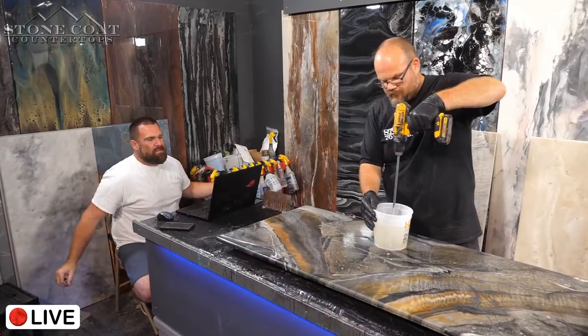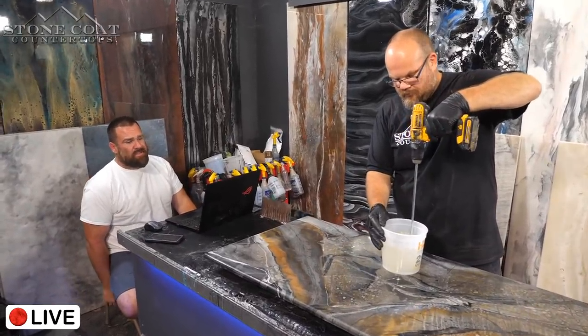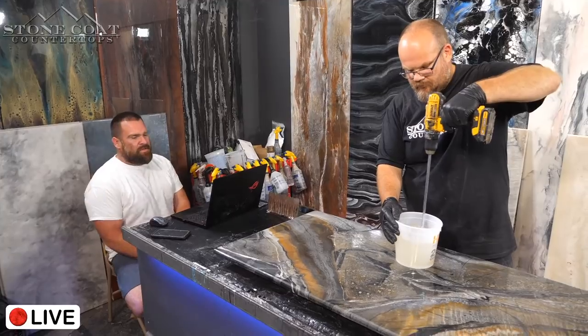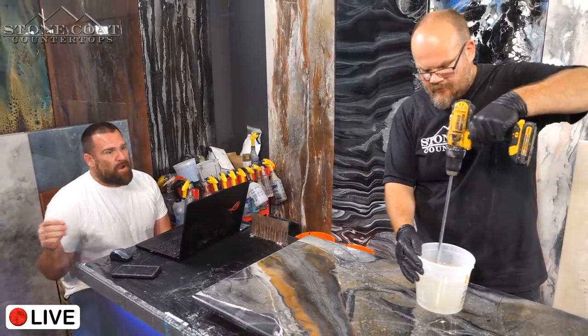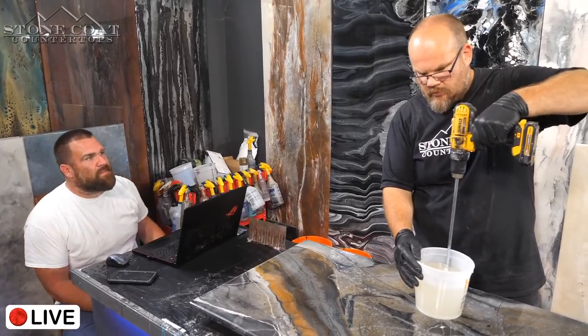So Catherine asked, the side stripped a bit on her project. Can she sand and tape that over? And I was just typing in. Oh, you better let her know, Mike, because you're mixing. Yeah. Let her know about fogging on color and chopping on color before applying that clear coat.